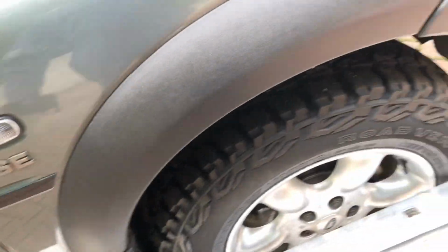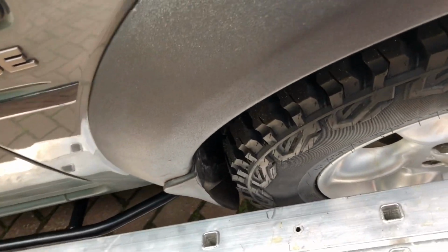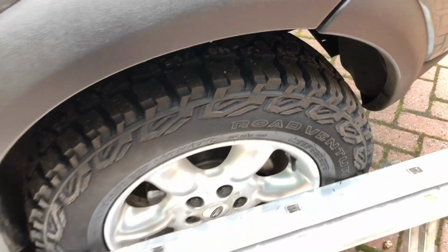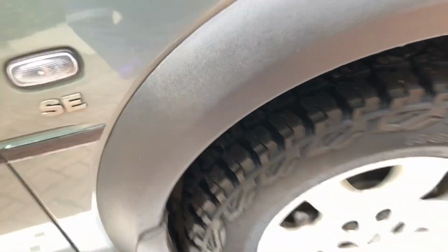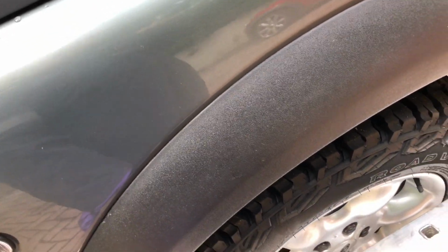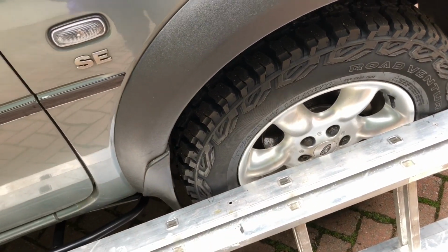So for instance now, a quick way of checking for drastic misalignment is to stick something straight, like this pair of ladders, and make sure they're straight. You can see here on the front wheels, there's quite a big toe out now, and that would be expected because the steering arms having drooped, they'll be pulling the back of the wheel in and making it toe out. So we need to adjust that first, and then once we've got the front correctly set for toe in, toe out, confirm it with the Gunson Track Right, adjusting it equally on both sides.